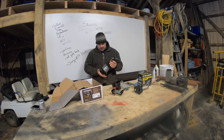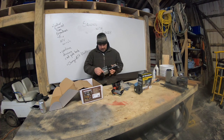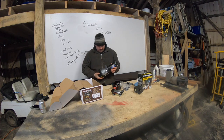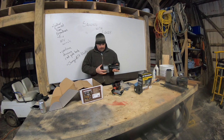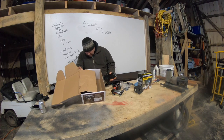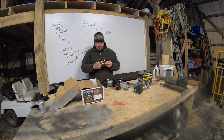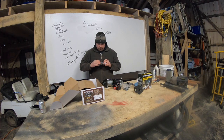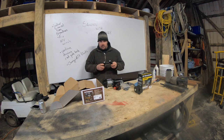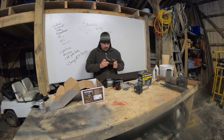First impression after unboxing: it feels pretty robust. The housing is cast iron. There's steel cable, 50 feet, three-sixteenths of an inch thick — big difference from three-eighths. Four-way roller fairlead is included. My first impression of the fairlead: it looks pretty good, doesn't look like a cheap unit. It looks like it'll be equally as good as the unit that came with the ATV. All four rollers seem to spin quite well.